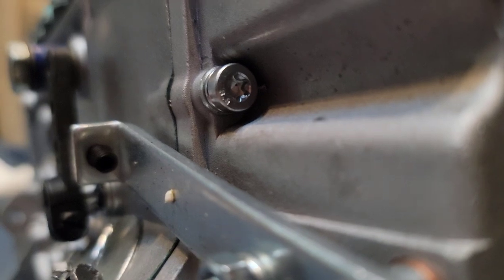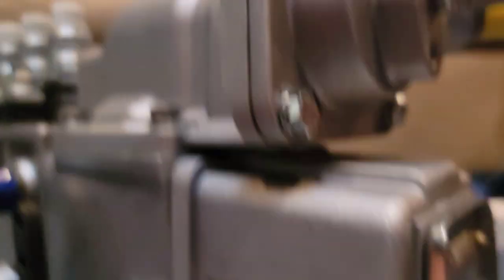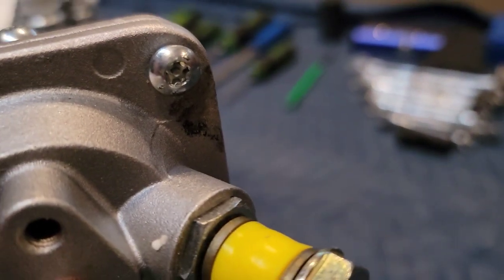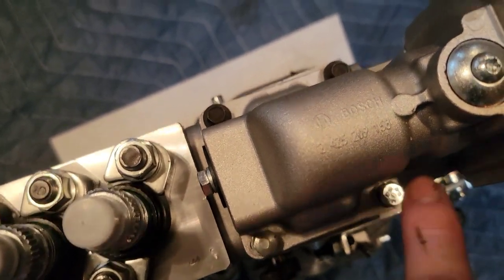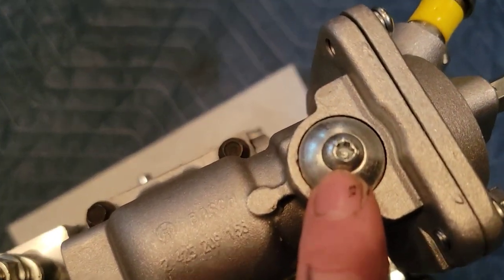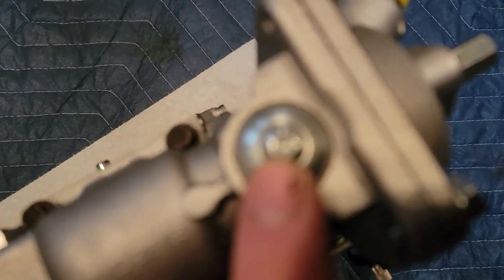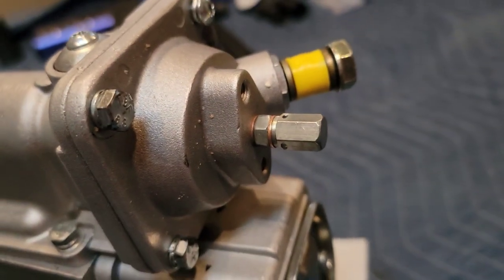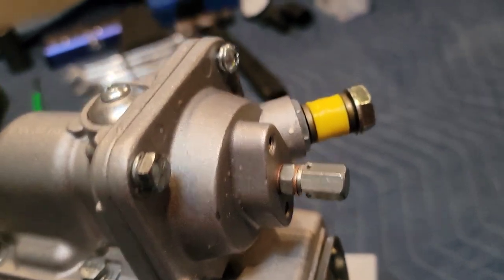The five-point head — I don't know how I'm going to get those out. Luckily I don't have too many of them. There's no security or snap-off screws on the main ones, so you have 10mm and 10mm, and then those same five-sided star bits. The AFC housing is 10mm, 10mm, 8mm, 8mm — so that's nice. They obviously know you're going to get in there and mess with it anyway. This one security bit is five-sided and that's going to be really hard to get out; I definitely want to swap that out because I'll be adjusting my star wheel frequently. The smoke screw has a slightly different setup too, which is nice because they leave it open for you to adjust right off the bat.